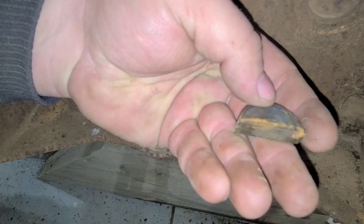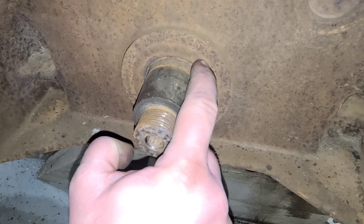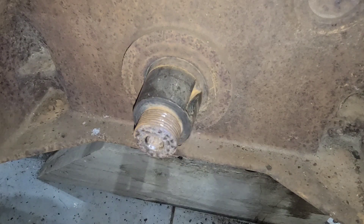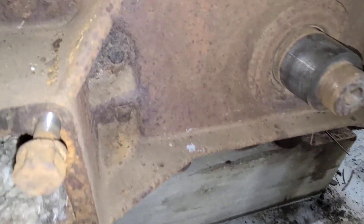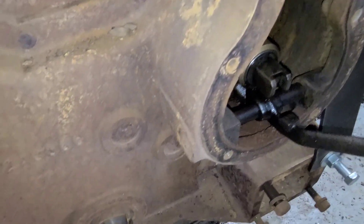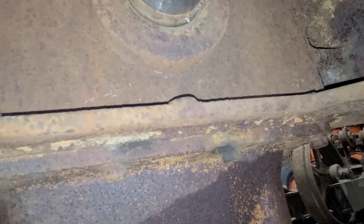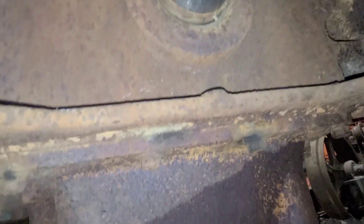And there's the key — looks to be in good condition. The whole point of removing the key was just to not tear up this seal as we come through with the front cover. We should be able to start pulling perimeter bolts all the way around here. It's also worth noting we will have to pull four of the oil pan bolts to get this to slip out of here.